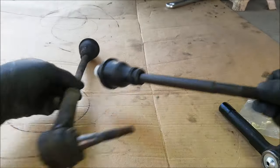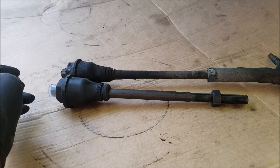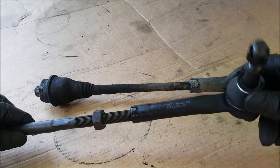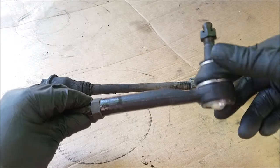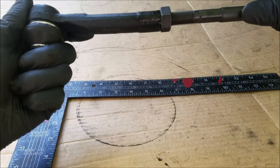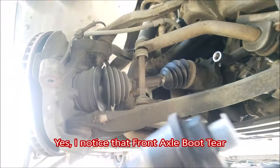So now let's begin by installing our nut onto the inner tie rod — just thread it on about as far as the old one was. And now we can get our outer tie rod and install that by screwing it on. Now that we got that all assembled let's check our measurement. And look at that, it's right on the money. We're now ready to install that on the truck.